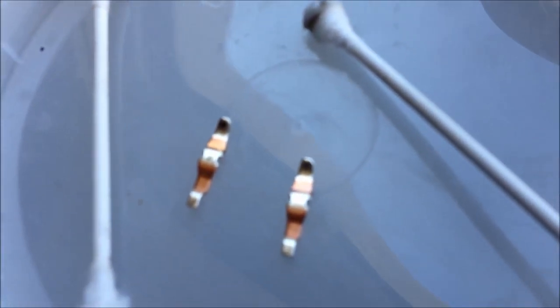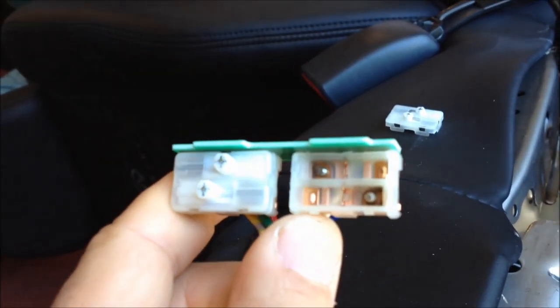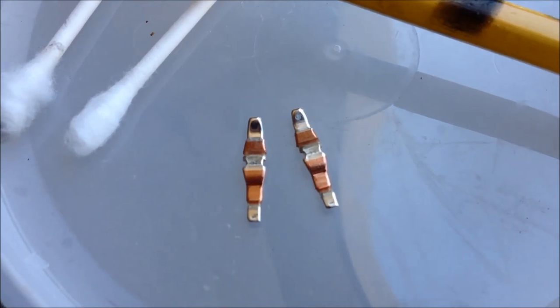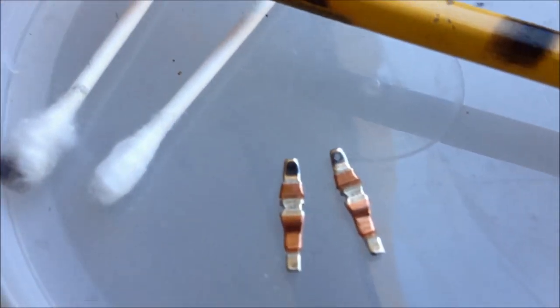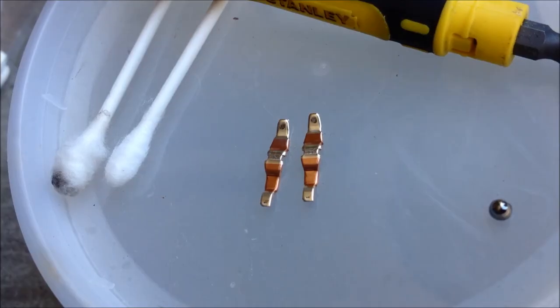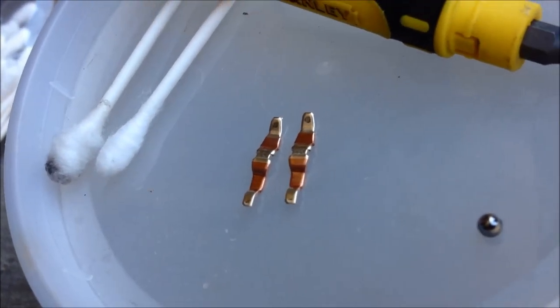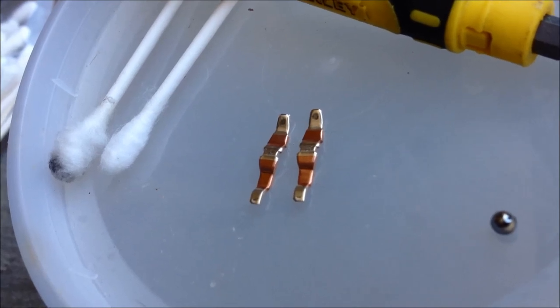Here we have the dirty Q-tips and the cleaned-up contacts — they are a lot cleaner. I'm still going to try an eraser on it, and I cleaned the inside of the switch — it took all the charcoal out so now it's going to make a good connection. I used a pencil eraser and one became very clean and the other not quite as clean. Finally, I gave it just a little scrape with my screwdriver tip to clean the remaining charcoal off, being careful not to cut any gouges into the switch — I want a nice smooth surface.